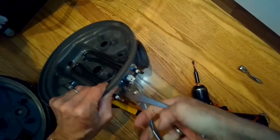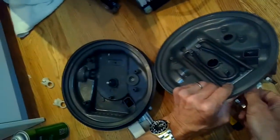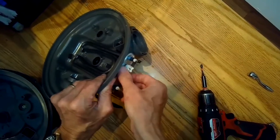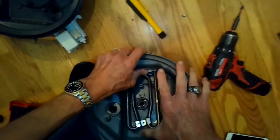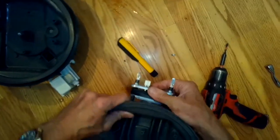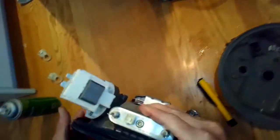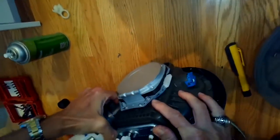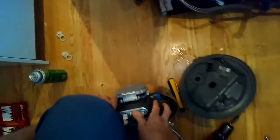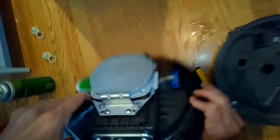I'll get the machine up on its feet, pull it out, and now I'm taking the heater assembly out. I'm loosening this nut — I use pliers to do it, but you can use a ratchet too. Just spin that off and now we can get the heating element out. You have to push pretty hard from the bottom and push it out of the plastic assembly. Grab our new one, put that in, push it all the way in as far as it'll go, and use a fair amount of pressure with your hands to really seat it totally flat. Then put the little nut in — as the nut pushes down, it expands the rubber and makes a great watertight seal.